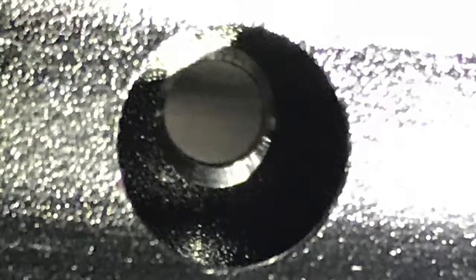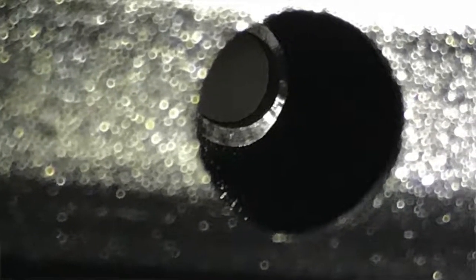What we're trying to do is take that hard square edge off the spoke hole where the nipple is going to interface with the rim. This increases the surface area contact between the nipple and the rim, and reduces stress on both the rim and the nipple.